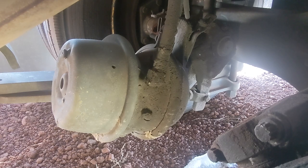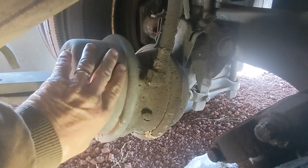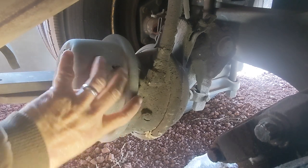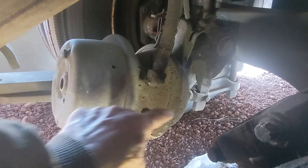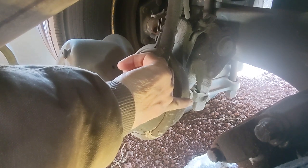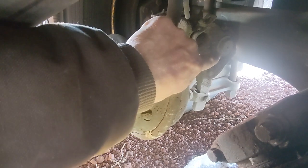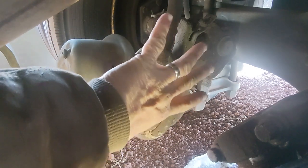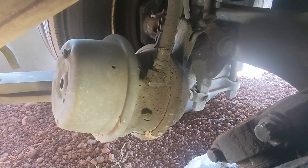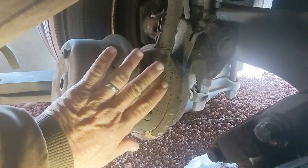Welcome down below the bus with me. This is your rear brake assembly — this is a spring brake. It has a big, heavy spring in here that is pushing on the rod, and that rod or shaft pushes on the slack adjuster — that vertical arm that rotates around that bolt or pin — which goes through to an S-cam, and that's what spreads your brake shoes apart inside the brake drum. Right now the brake is applied because there's no air pressure.